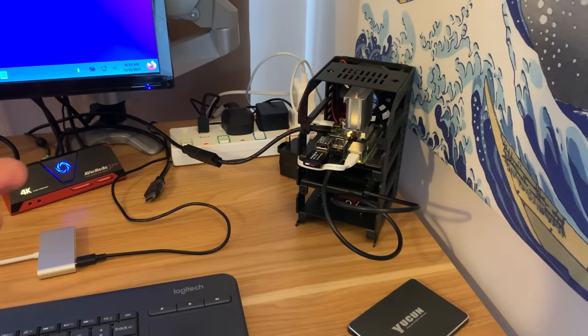Anyway, I need the Bluetooth bit and add device. But before I do that, let's just start this keyboard in a pairing mode. So I think I press and hold it for a bit and it goes into pairing. You can see it's flashing now. Put it near the Pi Zero and add device. It always finds loads of Bluetooth devices. I don't know what most of them are. My TV comes up and my Bose speaker comes up. So there's no keyboard there yet.